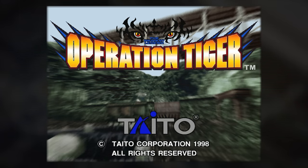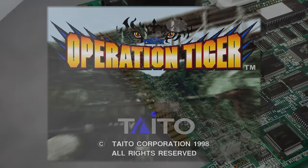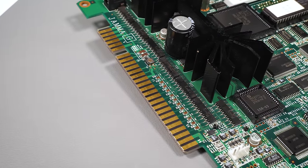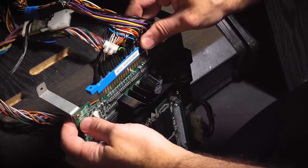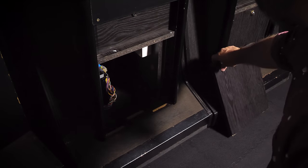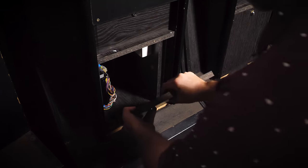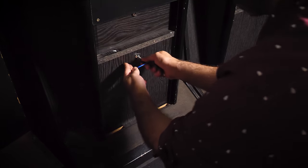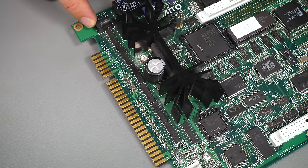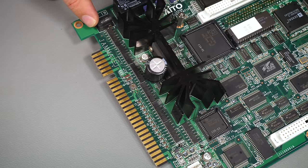The sound system is shared across Taito platforms. A JAMMA edge connector is used to plug right into the harness of an arcade cabinet, feeding the system's audio and video output to the cabinet while receiving control input, power — the whole thing is powered through the JAMMA connector, which feeds down into the motherboard — and the coin mechanism input, so it knows if a coin's been inserted and a credit applied. It's convenient for your chain-smoking grumpy arcade operator of the period to pop into a machine and quickly have it up and running. There's also a secondary DC barrel jack which appears to give it a bit more juice if your cabinet isn't up to the job.